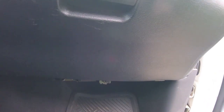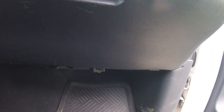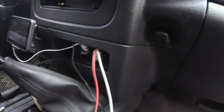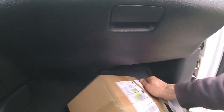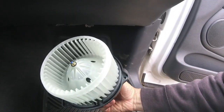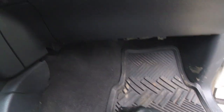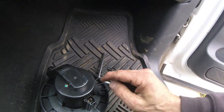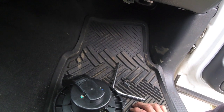But I don't want to rely on that, because if this thing dumps out, it's going to dump out in the middle of a snowstorm. That was my concern — it was snowing, and after dropping elevation about two hours out of the mountains, on the third hour it was really making noise with hard rain, trying to keep the windshield defrosted. So what do you do to fix this? You go on the internet, spend 30 bucks. I got this through eBay — it's a replacement motor. Three bolts, they're five-sixteenths or eight millimeter, both work. And then there's a simple harness that comes out. So let's drop this thing out and see what it looks like.